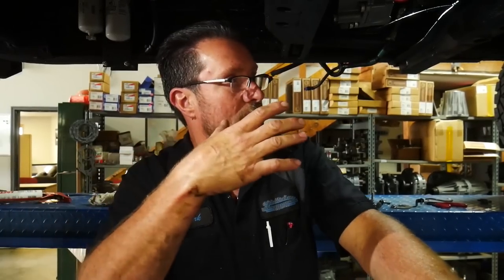On this particular deal, we can easily throw 1,000 horsepower at this case with no issues. If you were above 1,000 horsepower, it wasn't a daily driver, it wasn't a street-driven truck, we might consider not putting the CNC main shaft in, because you're not going to have the wear, you're not going to put the miles on it, just to totally increase the strength in it. Not that we weakened it by doing that, but this is more designed for daily drivers that are 1,000 horsepower or less.